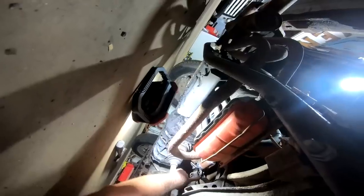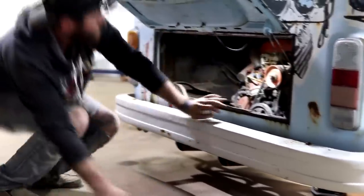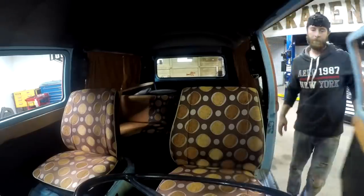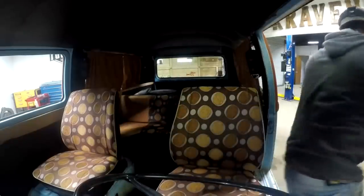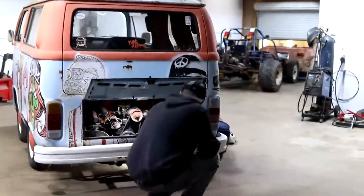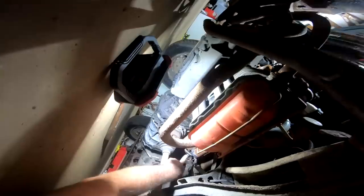It's got a pretty good bite on that battery now. Let me go ahead and give it another shot real quick. Okay. All right. Now, can we just jump it across at the solenoid there? Can you see where the wire comes? I can see where it comes. We may have a bad wire that's running up to the ignition switch.